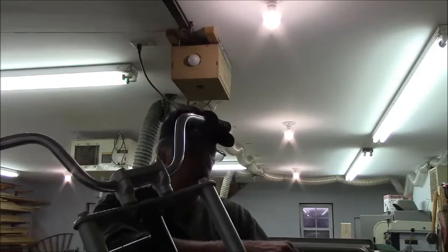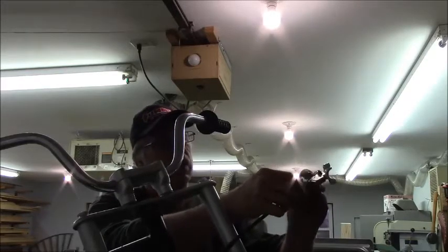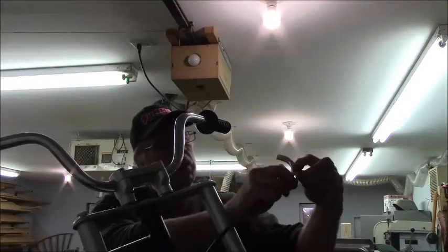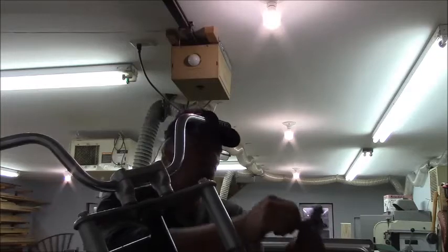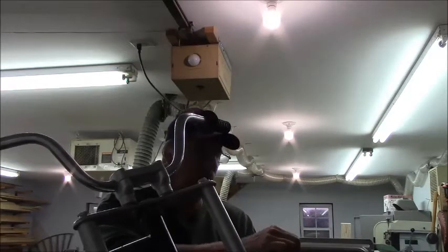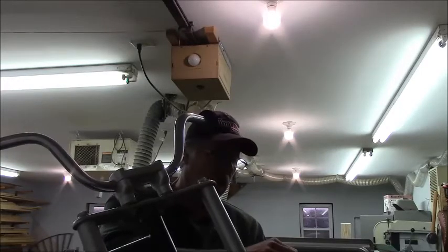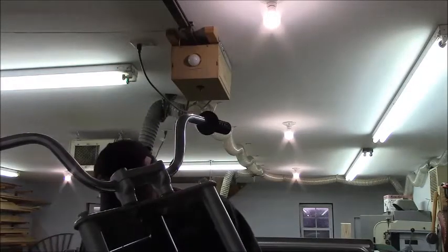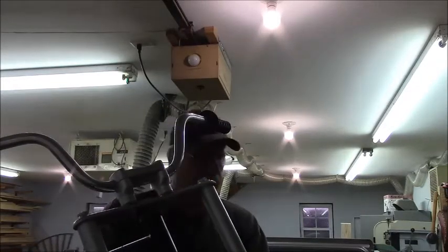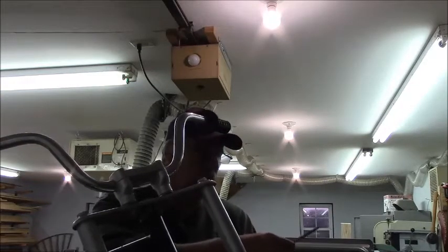I remember, I gotta back the adjuster all the way out. You back the adjuster all the way out and see how there's a T-slot hole. You turn the cable sideways, and then that barrel comes right out, I hope. Eventually, I keep working on it. Looks like it's been pinched a little bit. Maybe I need to twist a screwdriver in there a little bit, force that apart a little bit. Yep, that's all it needed.